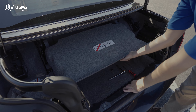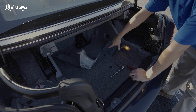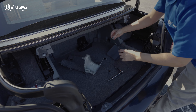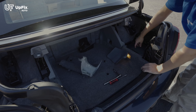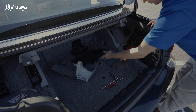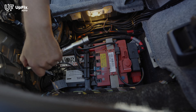On this convertible, it has this plastic piece — we want to pick it up and just push it up here. As you can see, I've already removed a few plastic pieces. This plastic trim folds over the top and has these plastic screws that you use a flathead — you just move them 90 degrees and they all pop out. Then you have this battery cover right here at the bottom, which has also been already removed. You can just take this out and now you should have access to your battery. The negative terminal is near the tail light. All you need is a 10 millimeter wrench to loosen it up.